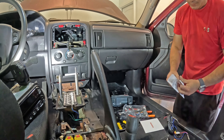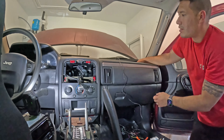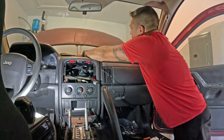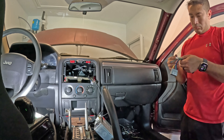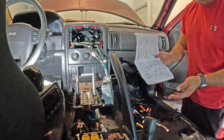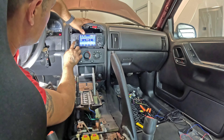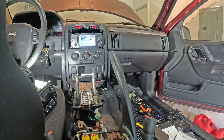My goal was to drive the Jeep at least 300 miles before delivering it to my mother, since I needed to flush the Sea Foam out of the engine and find any additional issues. I wanted and needed a backup camera and Apple CarPlay, so I installed an aftermarket head unit after watching Tyler Potter's YouTube channel. I was glad to find it because other head units usually remove the analog volume knob, which was a 100% need for my mother. Direct installation was simple since there was an adapter, but the additional connections were a little confusing — including the wiring, the camera power which requires an accessory signal I got from the 12-volt sockets. I also ran the GPS antenna to the dash and microphone to the driver side A-pillar. In about 30 minutes I was set up on wireless CarPlay and playing music.